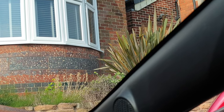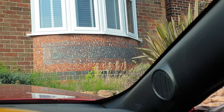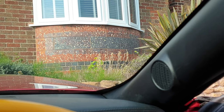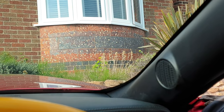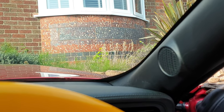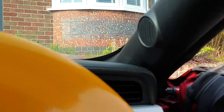The fuses on this car are Micro 2 blade fuses, so you need to make sure you've got the right piggyback fuse holder for that. I had to order one — I initially ordered a standard Micro blade from Amazon in error, not a Micro 2, and that was the wrong type. Halfords came to the rescue — they had one in stock and I got that sorted.